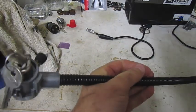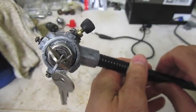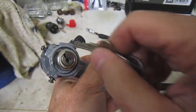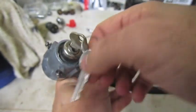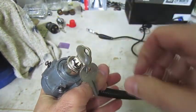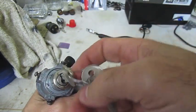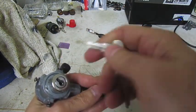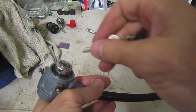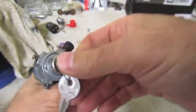Let's go back to the pop-out switch. A few interesting things about an original — or almost, this is close, it's an original type. They call it a pop-out switch because it pops out. When this is in your dash and you turn the key clockwise, it will pop out — see, it just popped out. When the switch is popped out, there's a connection from your battery to your distributor to start the car. It sounds a little backwards: you'd think with the pop-out switch out it's disconnected, but it's the opposite. When it's pushed in, it's disconnected. When you pop it out, you need the key to pop it out.